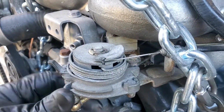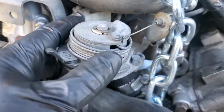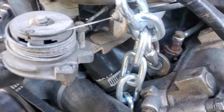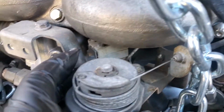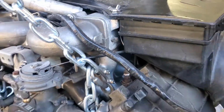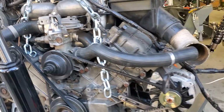I think there's also this right here. I'm not sure if you can see that. That little button, if you can hear that click, is called the kick down switch. The idea is that if you are at wide open throttle, of course this is at a weird angle for me to grab, this hits it and puts you into a lower gear. Basically, if you're at full open throttle, it's like, nope, you're in second, and pushes it to go down. If you're in third, if the RPMs are high enough, I don't really know. Yeah, I think that's about it.